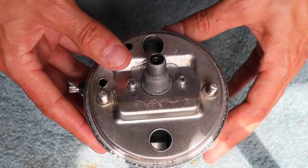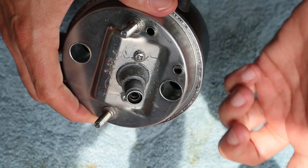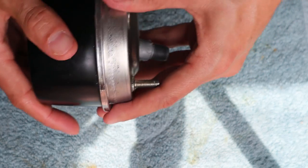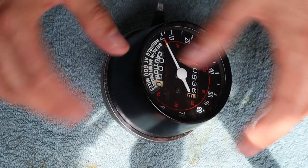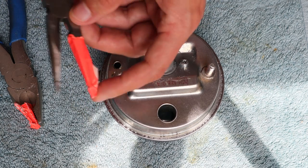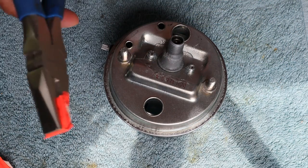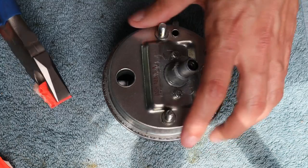I've got that all crimped in place. It actually didn't come out too bad — the edge is going to be a little rougher than factory but it's pretty well peened over and secure. Nothing's moving around, everything feels tight, and the rubber gasket should be pressed up against the back of the bezel nicely, so it should still be weather tight. What worked best in the end was graduating to a larger pair of needle nose pliers to pry the edges over until nearly flush, then switching to lineman pliers with taped jaws to crimp everything into place going around slowly.